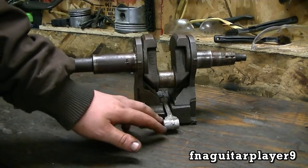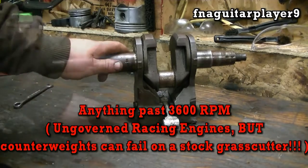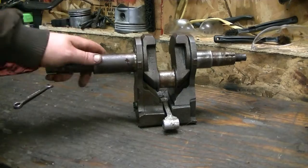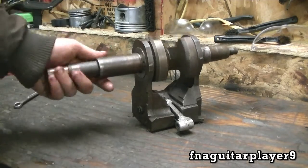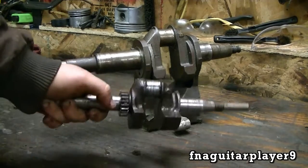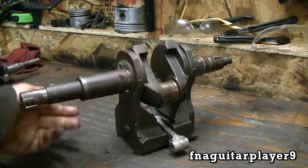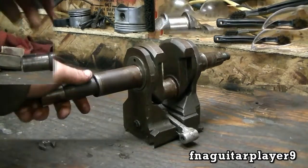Another reason you'd have to take these counterweights off is if you're building a racing lawnmower engine. You'll usually have to do away with these weights because they tend to be a weak point when you exceed the standard RPM of 3600. Because of the high RPM, this rod tends to break and the counterweights get thrown through the back of the crankcase, which pretty much destroys the block. What a lot of people do is do away with this whole synchro balancer setup and put brass counterweights on it, making the crankshaft more like this - without the synchro balancer - with weights built in. It's a lot more reliable. It's an expensive modification but it can save your engine, plus it cuts down on the weight of the internal parts.